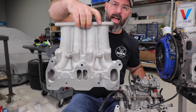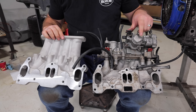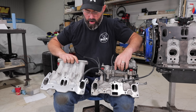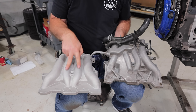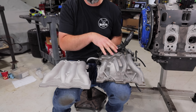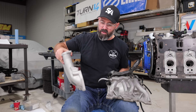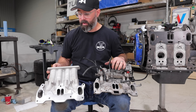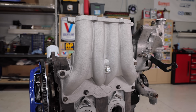We are going to install our Excessive Manufacturing lower intake manifold — a really nice cast aluminum piece. Side by side with the factory piece, there are some important differences: most notably it deletes the ACV (air control valve) unit, getting rid of a lot of vacuum lines and that whole rat's nest. Its routing of the two primary ports is also very different — two big primaries here versus much smaller, more convoluted paths on the stock one, which is more restrictive and struggles with balancing airflow. This piece flows 20% better than the stock lower intake manifold right out of the box, and its thick walls give you a lot of options for aggressive porting.